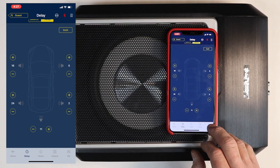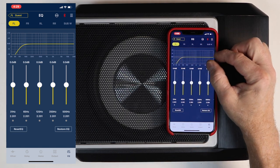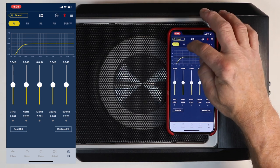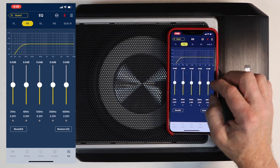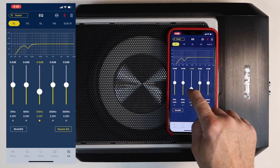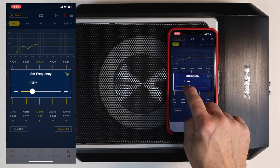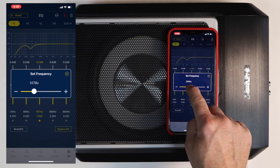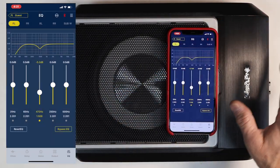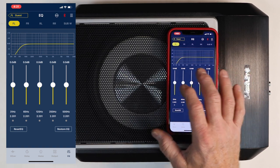Move over into EQ, located in the bottom right. On the EQ page at the top you'll see a displayed output ranging from plus or minus 12 dB, and it also indicates where your crossover point is for that specific channel — this lets you verify your crossover is set correctly. Scroll left or right to navigate bands, raise or lower them, tap the number to adjust the Q width, and tap at the top to adjust the frequency. Because it's parametric, you can choose whatever frequency you want, with 10 bands adjustable any way you see fit. If it sounds terrible, select 'reset EQ' and confirm — it's independent for all five channels.